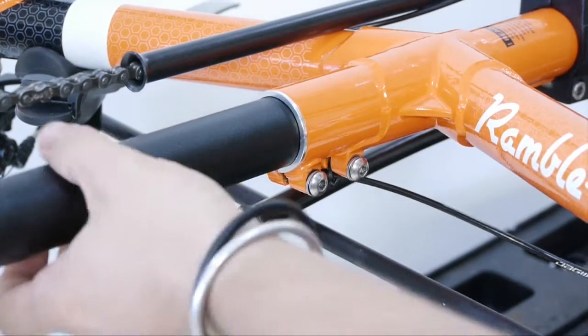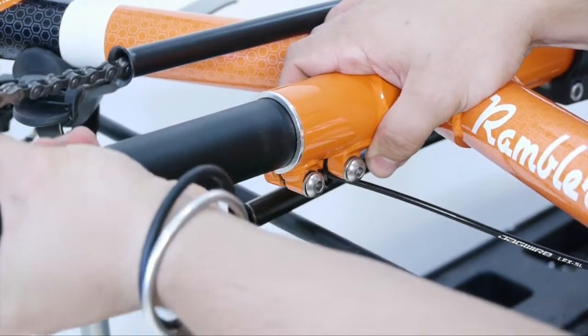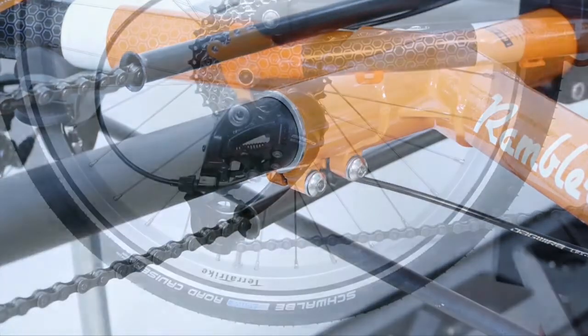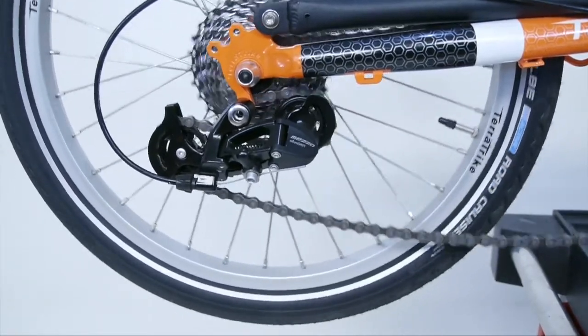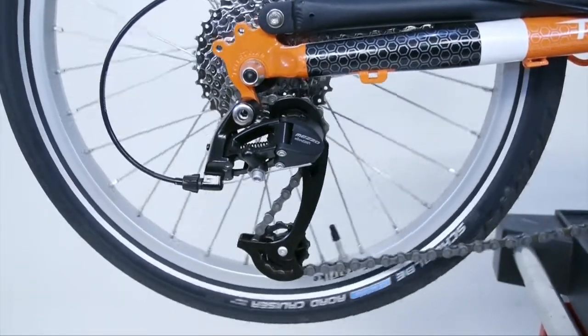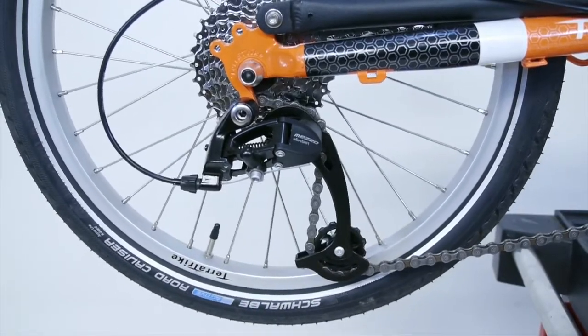Anytime the boom is moved, the chain must be resized accordingly. If the boom is moved to a larger size, chain links must be added and vice versa. You can use the same process for chain sizing as already described, but be prepared to add links and even another quick link if necessary.